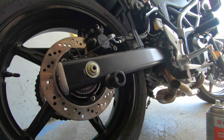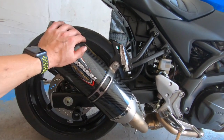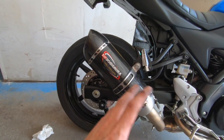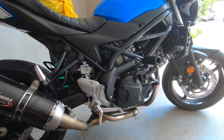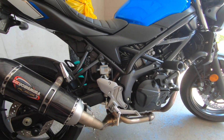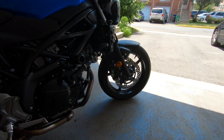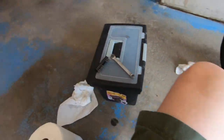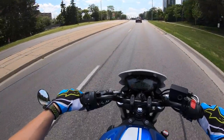Same thing — don't go nuts tightening. And pump your brakes a few times to build that pressure back up, because you will not have brakes the first few times you pump it. Don't go for a ride expecting everything to be great — pump them first, then go for a ride. It is hot today but at least we are done. Everything is put together, the brakes are serviced, everything is lubed. Last thing left is to hop on, take it for a short ride, get some gas, and test it out.